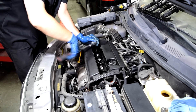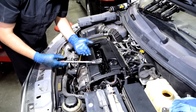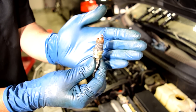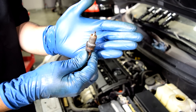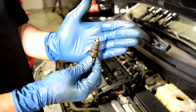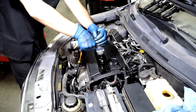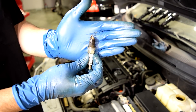That spark plug was really loose — all these spark plugs are really loose inside the cylinder head, which I guess is a sign that this cylinder head was overheated at some point. Spark plug number one shows nothing too out of the ordinary, pretty normal wear. Spark plug number two is a little wider. Spark plug number three is also worn but it's the cleanest of the three — the porcelain part in the middle is the cleanest so far. Spark plug number four is also just a little worn, with some minor deposits on the porcelain.